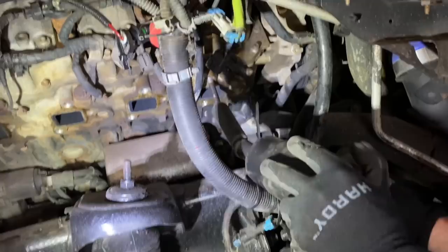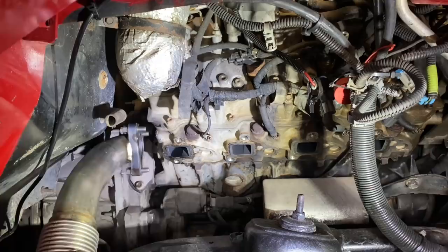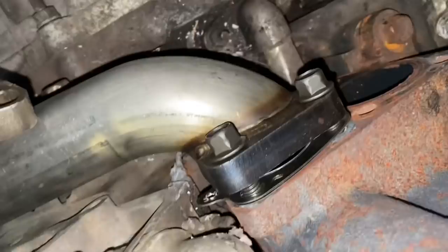That worked perfect. So I went ahead and just pre-gamed it, put the gasket on there with the actual bolts and just feed it right up through the top, right below the turbo there. It just makes life so much easier when you actually install that right there. But leave everything loose because you're going to need some wiggle room once you actually install this manifold.